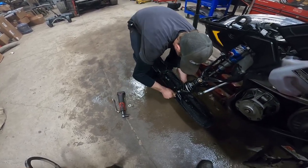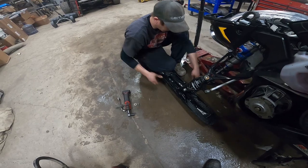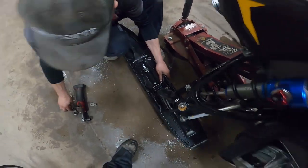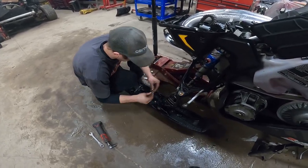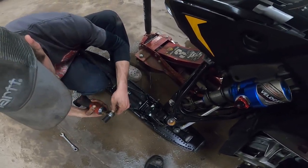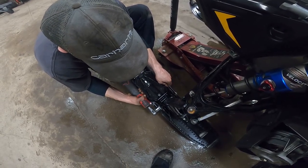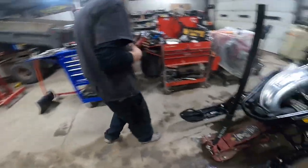Washer. So we're just going to take the bolt right out. Once that bolt comes out, we're going to pull it off and pull those bushings right off, push it over. Now it's on that side. You put your two bushings, and it's going to move that ski in. Put it back through. Make sure you have your washer. Washer on the back side with your nut. Simple as that. And he's going to torque it on there for me, and then we'll do the next one.